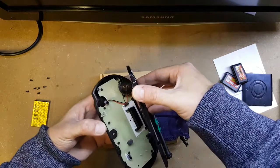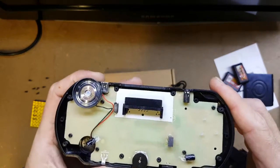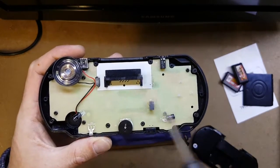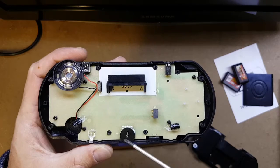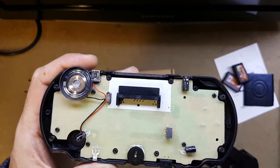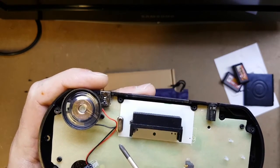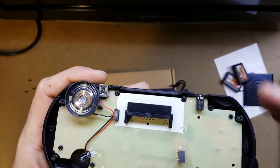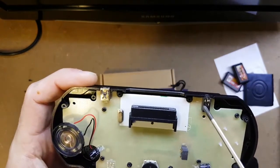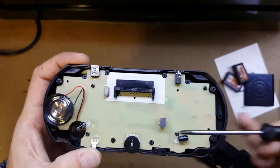Right, let's see. So that came back fairly straightforward. So what have we got? Not a lot. A couple of electrolytic caps, a bi-colour LED, a 10-kilohm resistor for the volume, a battery connector, there's a 27 MHz crystal there, a speaker just floating in the breeze, and the USB and audio-visual connectors, and clearly the cartridge connector.